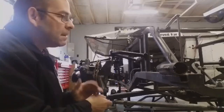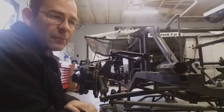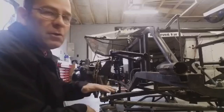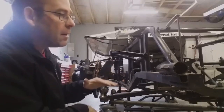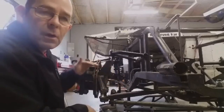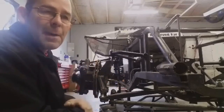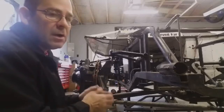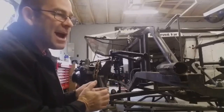Some other small things that will change your roll center — something as simple as tire height. If you go from a pair of 88-inch tires on the front to a pair of 91-inch tires, you've raised the nose of that race car up, which raises the roll center up compared to where it was relative to the back of the car. By raising that roll center on the front end, you've made the car tighter and made it not want to roll over as much.